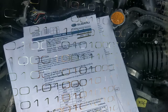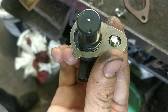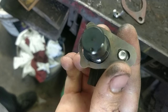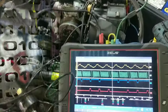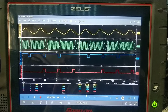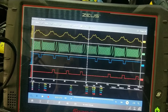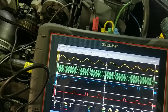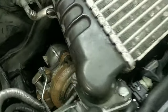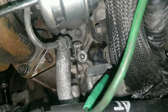We had to file down the shim to make the bolt hole line up, for whatever reason. We got a good waveform — intake pulse, crank. Blue is the right cam and red is the left cam. We tried an eight millimeter shim on this bank to get the waveform to flip like it's supposed to be, and it's still inverted.